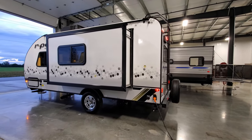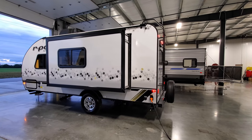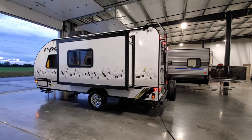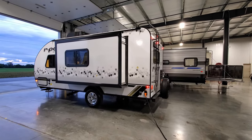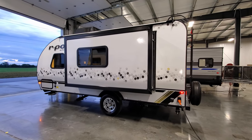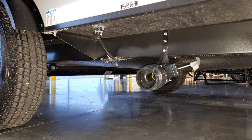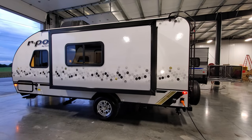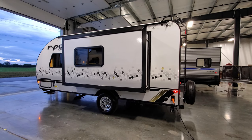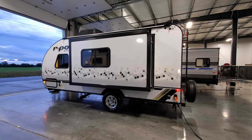On this back corner you can see the orange handle — that's your detachable power cord, a 30-amp electric service cord usually 25 to 30 feet long. You just detach it when not needed, roll it up, and store it so it's less likely to get cut off and stolen. Cable and satellite hookups are there as well so you can plug into a campground or home cable system. There are two dump connections — the bathroom section in front of the axle and the kitchen sink section behind the axle. Your gray tank is in the back, black tank in the front. This is done because with the torsion flex axle and the RV sitting lower to the ground, there isn't enough ground clearance to run piping across.